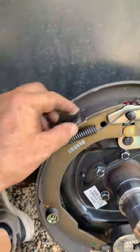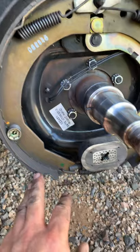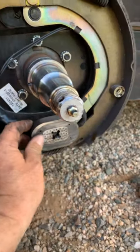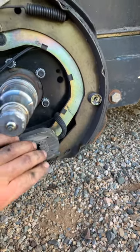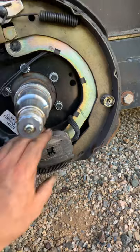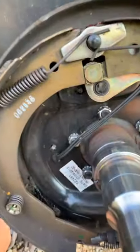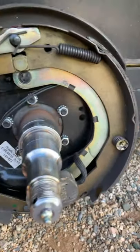One of the things that a lot of people overlook when they're doing the brakes: these brakes are in good shape, you can see they've got good pad here and the magnet is in good shape. The way this works is that the electric brakes magnetize this and it hits this outside metal part of the wheel, and that in turn pushes that - you can see how the brakes open and they stop the trailer.